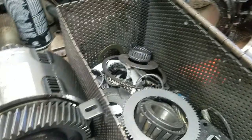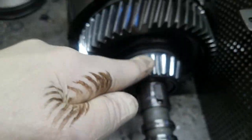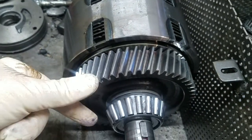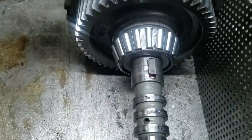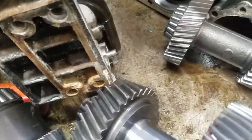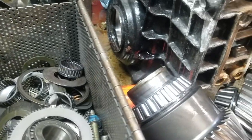So what we're gonna do tomorrow is we'll pull the pump key out, pull the gears off, replace the clutches on the pump end, and replace the clutches on the splined end of the input shaft. Give the gentleman a new filter and all that good stuff, new seals and all. Get it all taken care of and put it together for a good customer up in Northern Virginia.